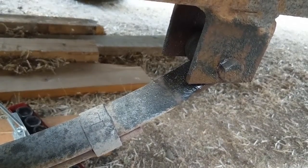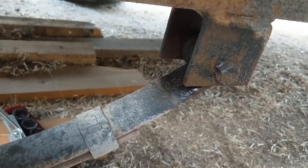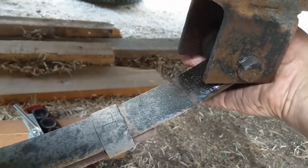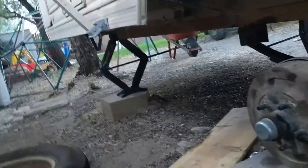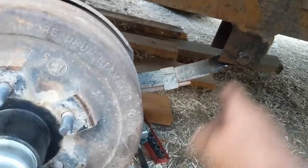I also have a stripped nut on one of these leaf spring mounts. My point being: when you get the nut pulled off this side, it's probably sensible to screw it partway back on and use a ball peen or a brass hammer to drive those out, rather than putting a big breaker bar here and spinning it to break it.